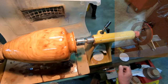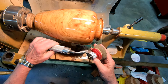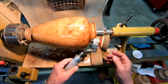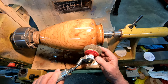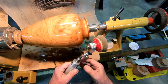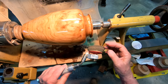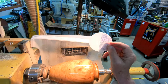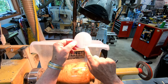Now, we're going to sand this with an inertial sander. This one is the sanding solution from the sanding glove. It's my preferred one. There are some copies out there. If it bothers you to buy other people's copies, people that copy other people's work, then you want to find the original sanding solution if you want to purchase one. It comes with different accessories, and the pads can be changed, and you can change the angles here. This particular pad is a 3-inch pad, and what we're going to be using on that is this 3M 260L P600, 600 grit.